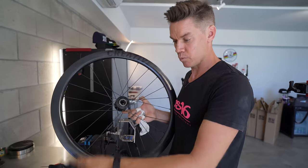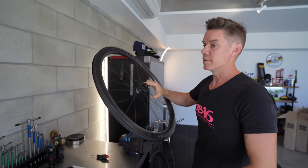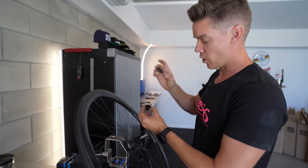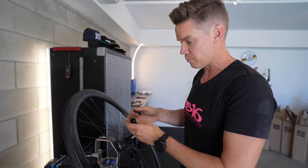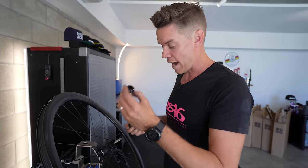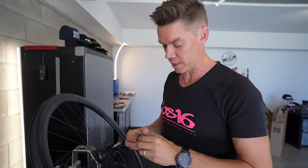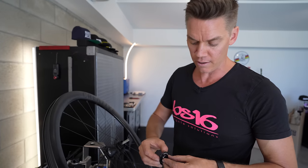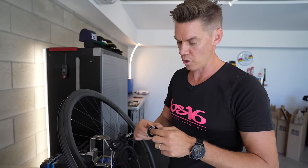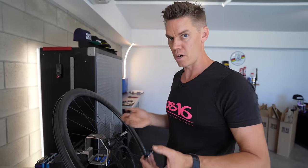It's not one you'd do at home — you need tooling to remove the hub shell. With the Chris King hub, the Extra Light hub has a micro-adjust lock ring on the left-hand side, and the disc brake lock ring will not go over that micro-adjust ring. So when you get the brand new hub set or if you're swapping rotors, you have to remove that first, install your disc brake, and then put the micro-adjust ring back on afterward. We have to make sure you use either the Shimano or Godfrey-style lock rings, not the internal spline lock ring that uses a normal cassette tool. But once you've got your rotor on, most people are not going to be taking it on and off all the time.